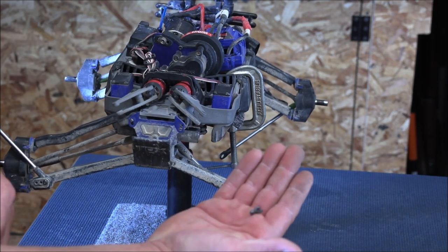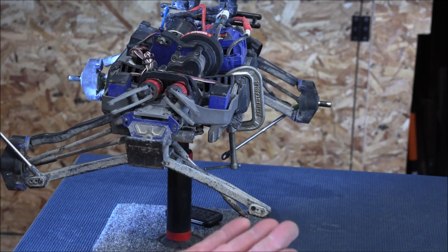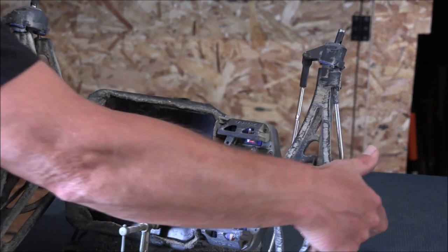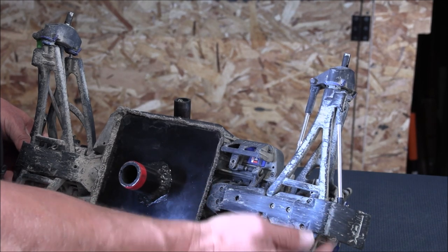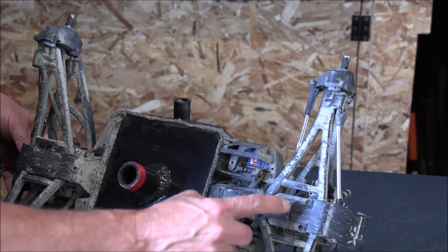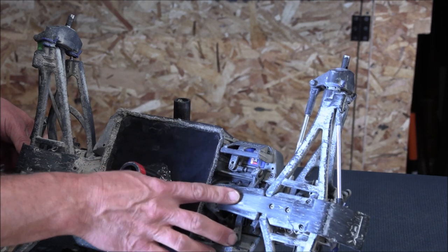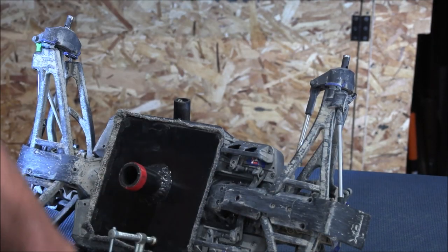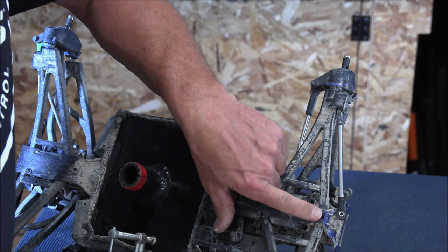Now we've got everything taken off our control arms with the exception of the push rod we just disconnected. We can disconnect it here - there are three holes, and I'm running the top position for the most clearance. Stock is the middle; dropping to the lower will drop your car as low as it can go. Make sure those three holes are lined up the same on both sides. To pull the upper control arm pin out, use flat bill pliers and just pull the pin right out in one piece. Now as you take this control arm out - it's only on the top one and only on the front - there are going to be four clips, two on either side. Before you pull the pin, orientate yourself with where the pins are at because that's how you adjust your caster.